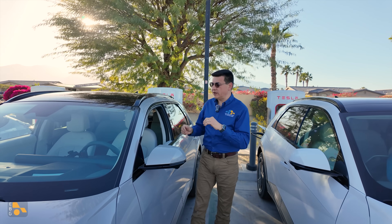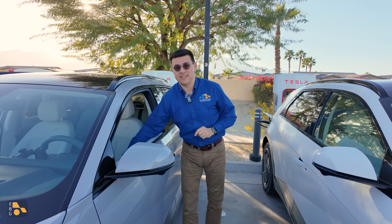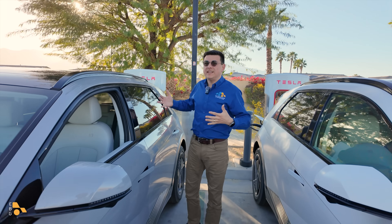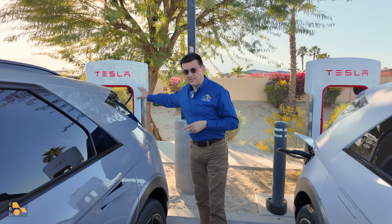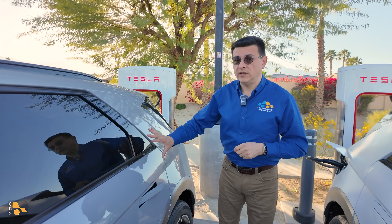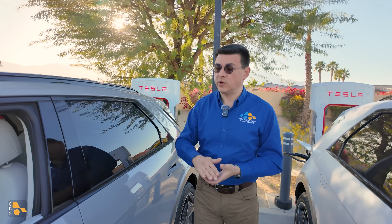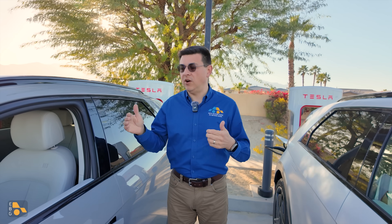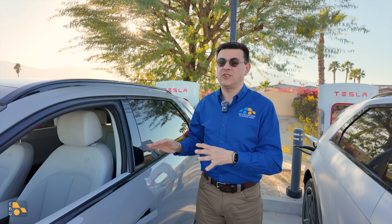While we wait for the charging to complete, let's talk about why this is charging slower than at an Electrify America station. The voltage of this particular pack, according to the spec sheet, is 697 volts. It's important to remember that when talking about 800 or 400-volt systems, there's obviously a range — 800-volt vehicles are basically everything over about 500 volts nominal. The way we get this 800-volt EV to charge from a 400-volt station is by a DC-DC conversion technique that Hyundai is using. It's integrated into the rear motor electronic module, and it uses one of the loops on the electric motor as an induction loop, allowing them to boost the incoming voltage from about 400 volts up to the 700 or so volts required to fully charge this battery. That process is not perfect — there is loss, and there's also a limit to how much power the onboard system was designed to convert, which looks to be right around 127 kilowatts.